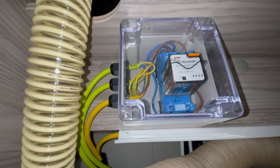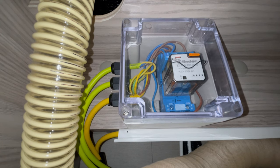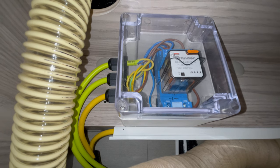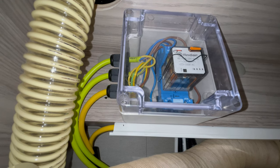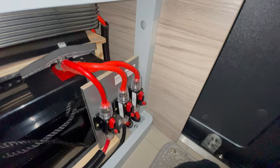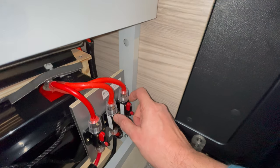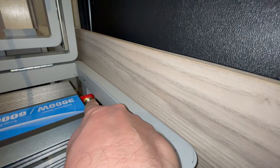You can probably see some of the connections in the relay box there. We've got three different cables feeding in: the input from the inverter in the yellow one, and then the lime-green colored one takes the feed from the mains, and then from the common out to the sockets. So just three wires running into that box. Just a reminder to finish things off — I'm going to be replacing these with a switch and putting inline fuses rather than using these breakers, which is a bit safer.